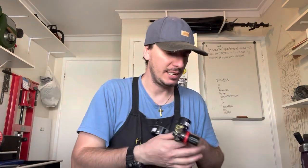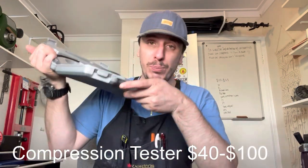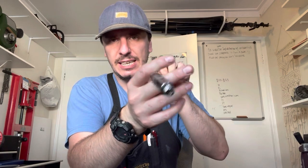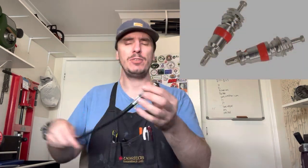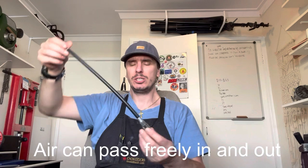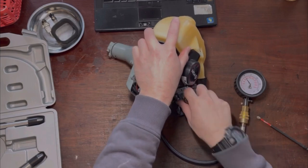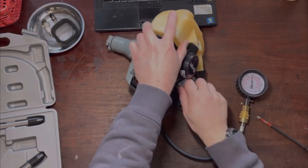They're different tools but I'm going to put two together. A compression tester and a leak down tester. The most important thing when buying a compression tester is to ensure that the spark plug adapter — the one that goes into the cylinder head — has a Schrader valve in the end of it. If you haven't got that Schrader valve, this tube acts as part of your cylinder head, hugely decreasing the amount of compression you should actually be reading. It doesn't have to be expensive — don't spend a lot of money. Just make sure it's got the Schrader valve in it. Nine times out of ten it's going to be more than accurate enough.